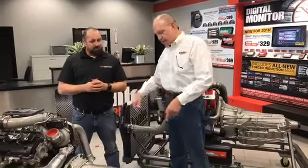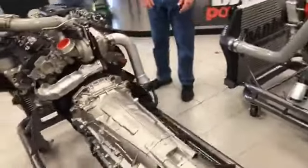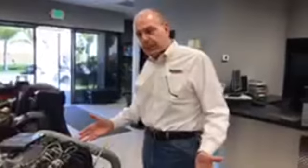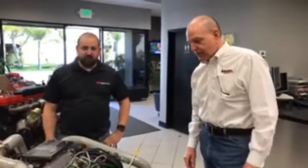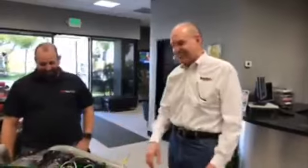As we walk over to the truck, Gail points out the electrical. They did their own ECU that'll run anywhere from a one- to eight-cylinder diesel engine up to 8,000 RPM. They use it for racing and for all their military engines. The intake manifold was also developed for military use, but it's racing technology. The ECU talks to the transmission through a bridge that speaks GM language and J1939 CAN to their controller. That's the electrical control part of it — a lot of really cool tech. The engine is familiar, but the electronics and engine control are all Banks, all developed here in Azusa, California.